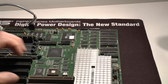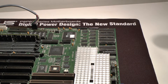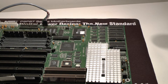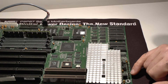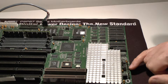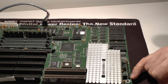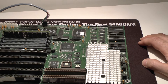That's the system BIOS on this machine — it's a flash BIOS. You can update it with a simple floppy disk. On the front you've got all your connections: your hard drive LED, your speaker connector, your hard drive connector, your power LED connector, and your reset. So reset, power LED, speaker connector, and hard drive connector — all fairly self-explanatory.